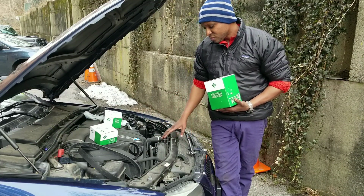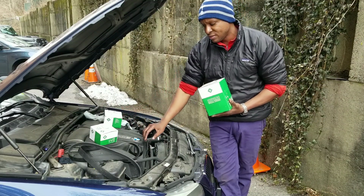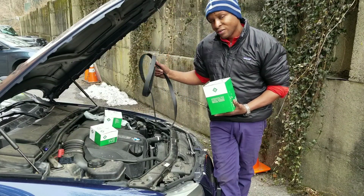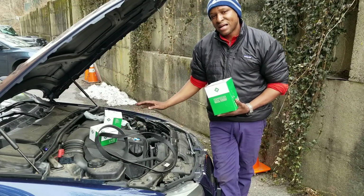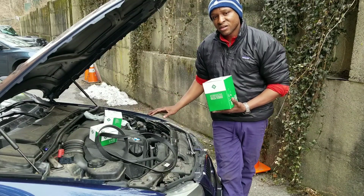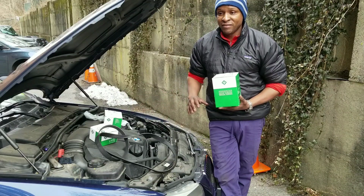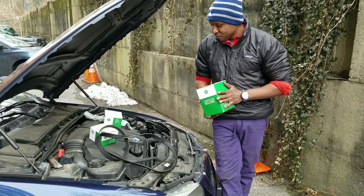That's about it. The parts came in. It's the tensioner and 2 pulleys I'm replacing, as well as the original engine belts, which are covered in oil from the oil filter housing gasket that leaks onto the belts. Now the car only has 57,000 miles, which is weird. The sound's been going on since 55,000 miles. So it's weird that this would fail so prematurely, but it's something most owners of this car will have to do every 50,000 miles, and I expect to do it again in 50,000 miles or so. And that's the story.